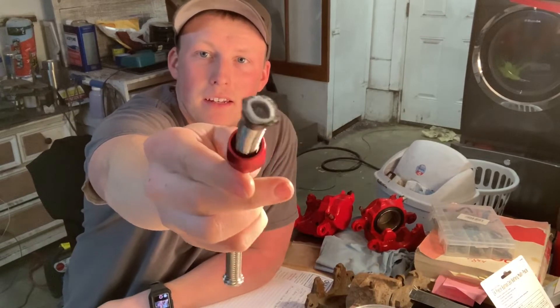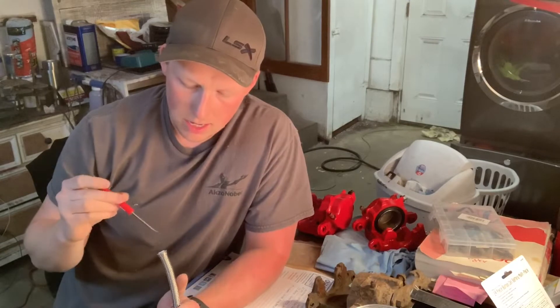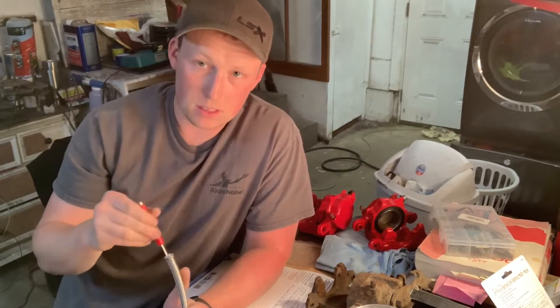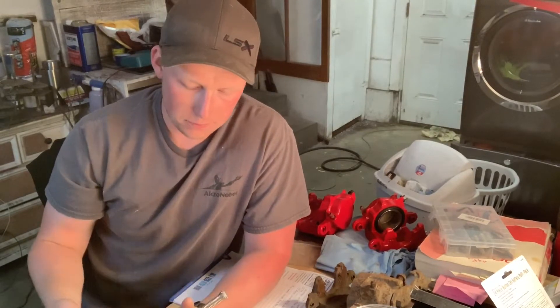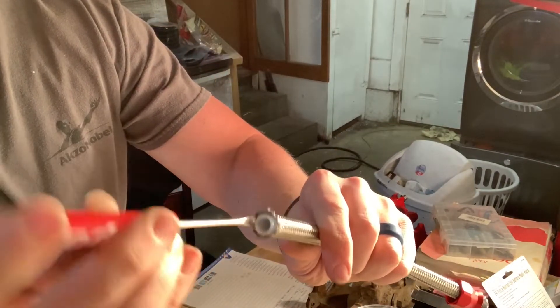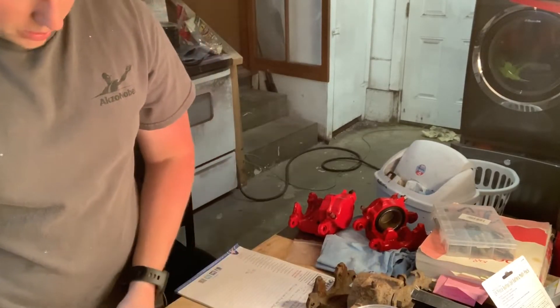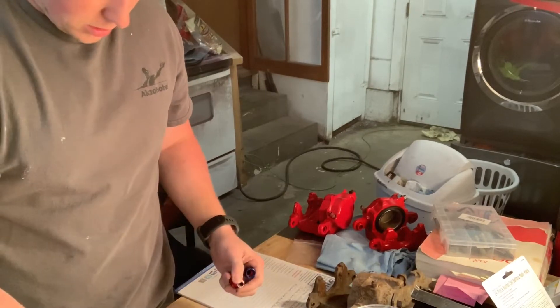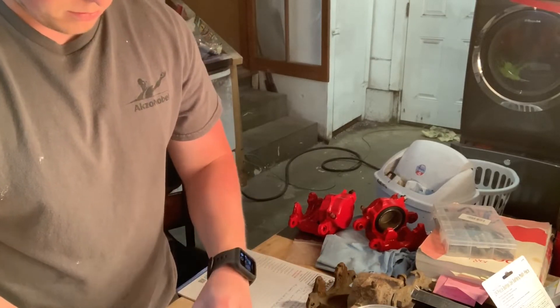Basically that's what it looks like after you cut it. I take a small screwdriver — just a regular Phillips head — and kind of waller the hole out a little bit to stretch it back to its circular shape. Not applying a lot of pressure, just forming it back. Then I take this end and get it between the PTFE and the braided fuel line, making sure to leave space for the collar.